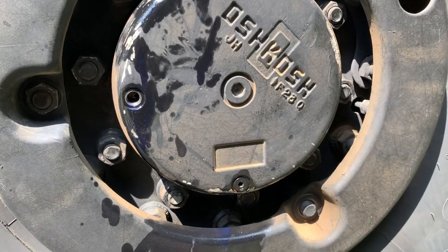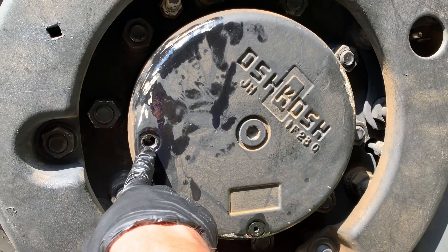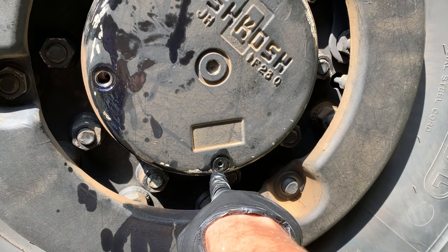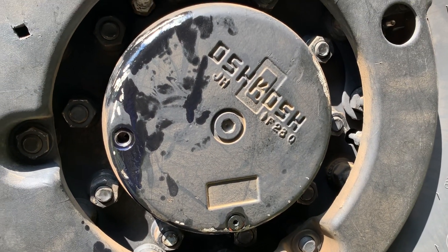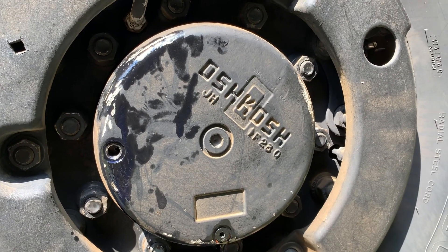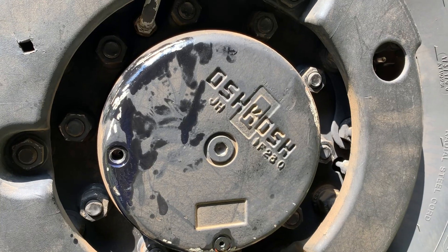You never know with these things — it's always kind of a crapshoot. Check your fluid, top off, change it, whatever you want to do. Pull your truck forward or backwards until you have one of your outer plugs sitting dead level, and the other outer plug is straight down. You do not want to get one of the plugs up top and start filling — you'll get the hub overfull, blow your seals, overheat it, and it won't dissipate heat like it should. It's just a bad situation overall.